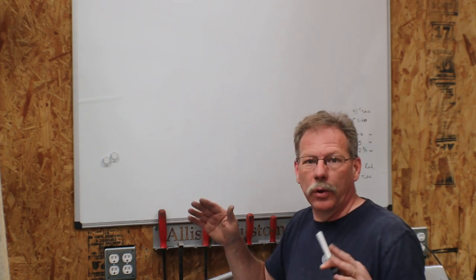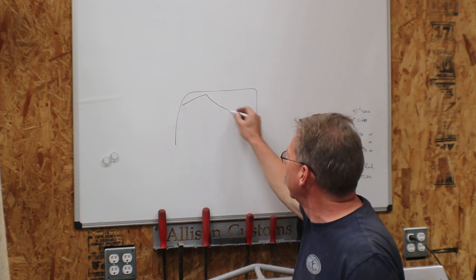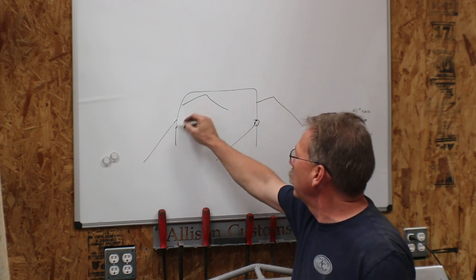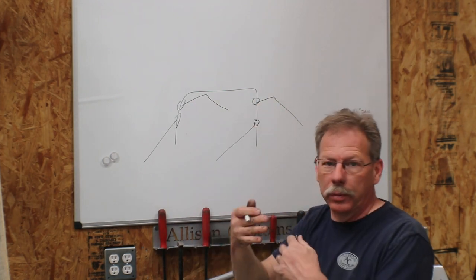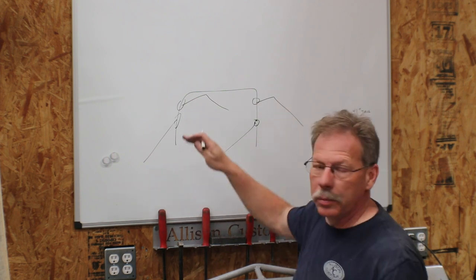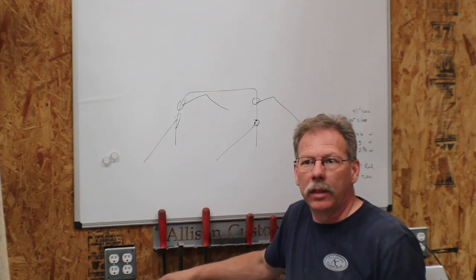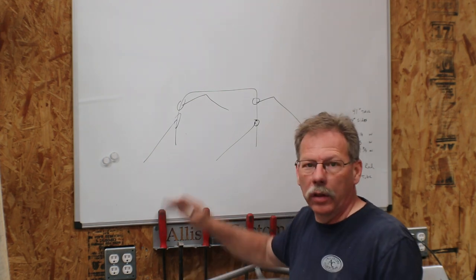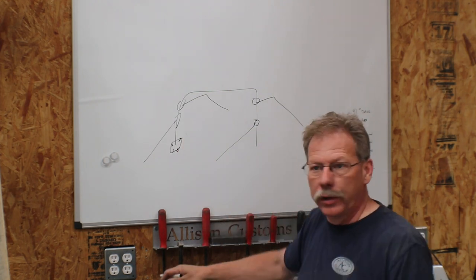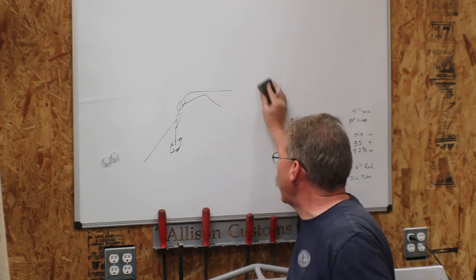If you're going to weld it in - which we're doing - whenever you get your main hoop, then you've got your down bars going behind the wheel wells or door bars coming forward. You could build some sleeves, slide them in, and bolt it together, and even if the main hoop is one full structure, these other pieces could bolt in and you could conceivably get a strong cage-type product that would protect you - welded outside on a bench, then bolted in through floor plates. We're not building that either. What we're building is as close to a cage as I can get without tying it into the frame.